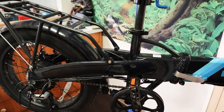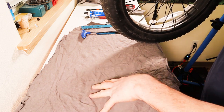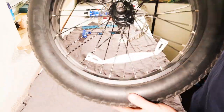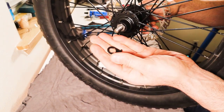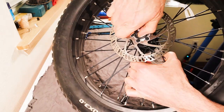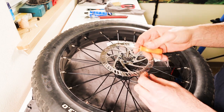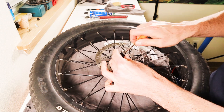Let's pull this whole hub apart and see what's in here. The first thing you want to do is lay out a nice cloth down so that when we pull the bearings out, they don't go rolling all over the place. It's always good to have a cloth down, and that way too the axle doesn't damage the counter you're working on. Go ahead and take these nuts all the way off now. Take the nut and the little safety washer off and set those aside. Then I use one of these little scribes — I'll leave a link in the description below to a set of these. They're super useful and just good to add to your tool collection.